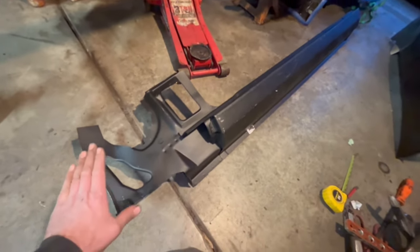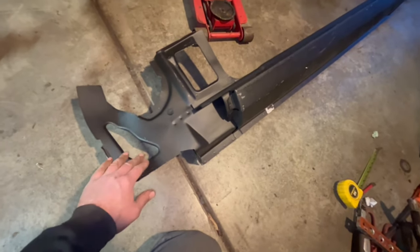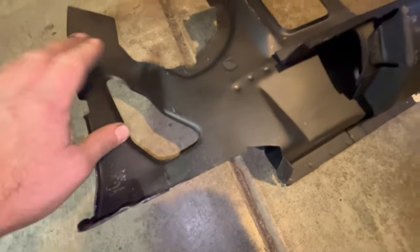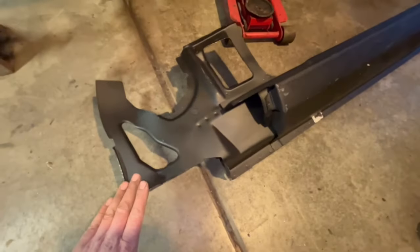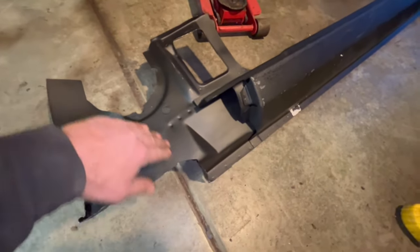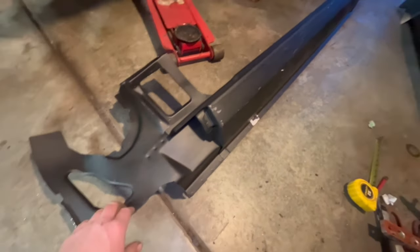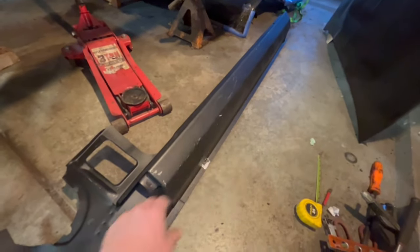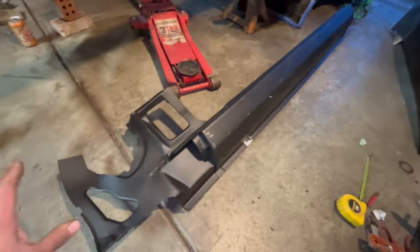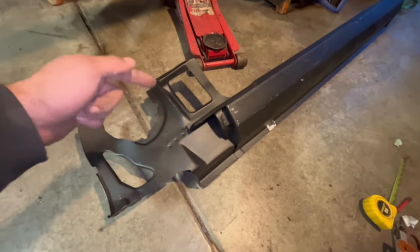If you were getting one for your car and didn't want to replace the whole panel, I would consider this really not acceptable — you can see that pretty gnarly crease and buckle. I bent it back because I need to measure from here to here as a reference point to know where to cut it to fit it in as my patch panel. It had a little damage on the bottom pinch weld, a kink in it, but it's metal. We can work with metal, persuade it back into shape. Not the end of the world.